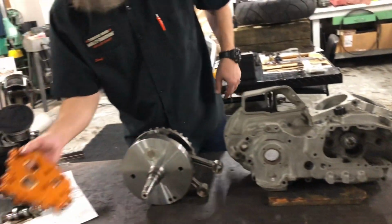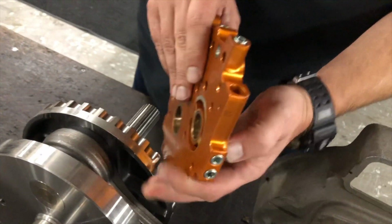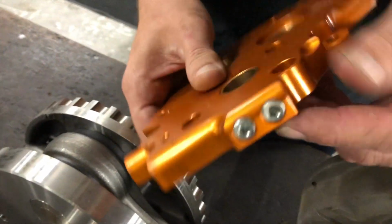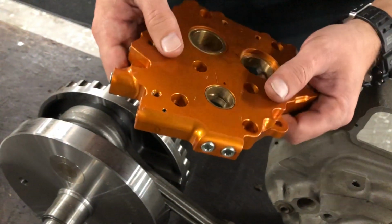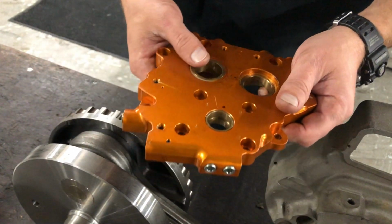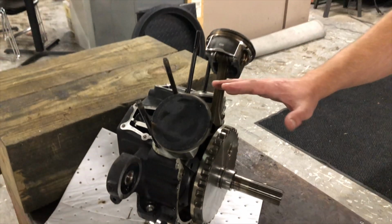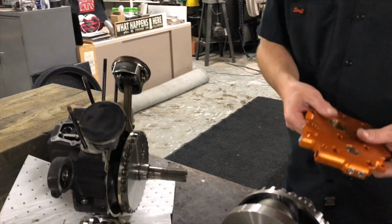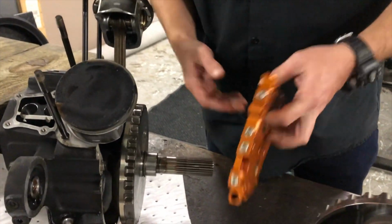Another big thing about these cam plates is that a lot of stuff inside of your motor depends on oil pressure. And you'll notice that there are a lot of little openings and such on this cam plate. Well, oil flows all through this, and there are valves inside of that that allow a certain amount of oil to come past, and that will pump up your lifters and shoot the oil out of the piston jets. Controls basically everything in there. And there's also an oil pump that goes in here behind this plate as well. It rides on this lobe. So that's pretty much everything on the bottom end of the motorcycle.